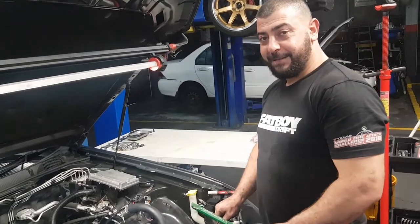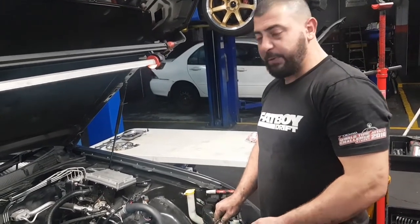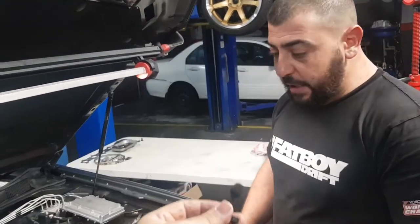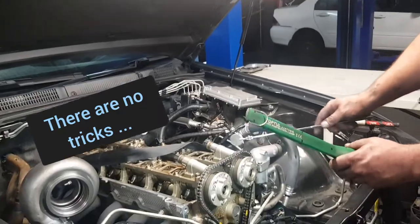But Youssef, you've got a few tricks. Now, are you going to tell the world your tricks? It's pretty straightforward, man. You get the marks up. There's a dot up here, a dot on each cam. They pretty much have to face up.